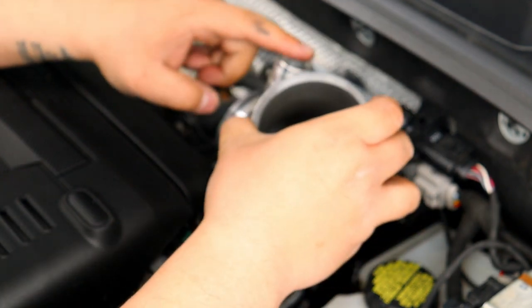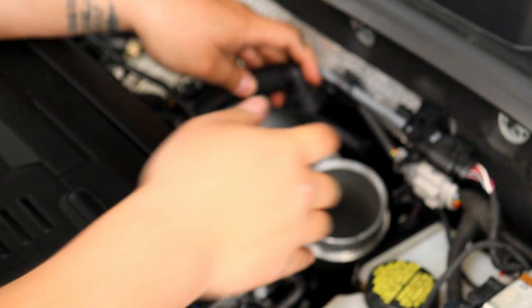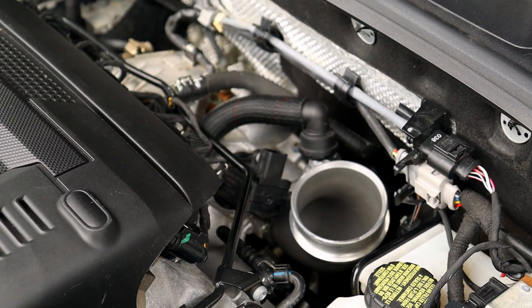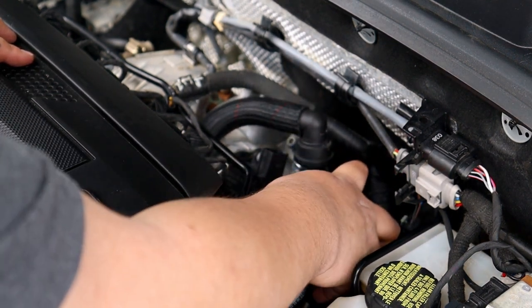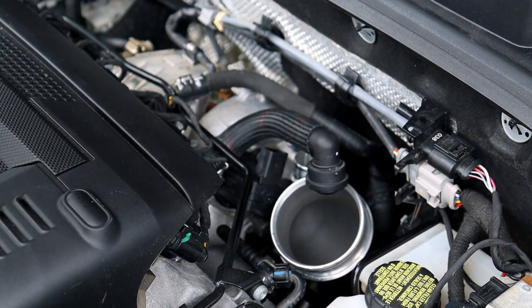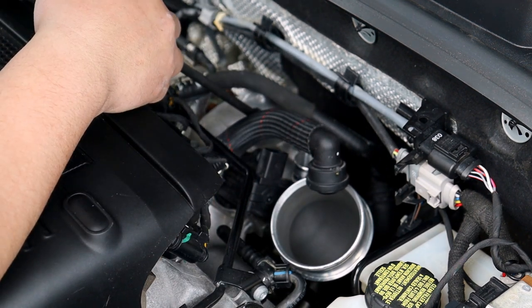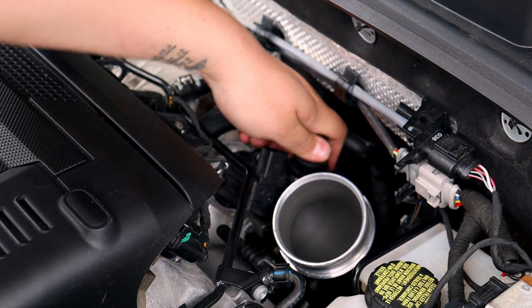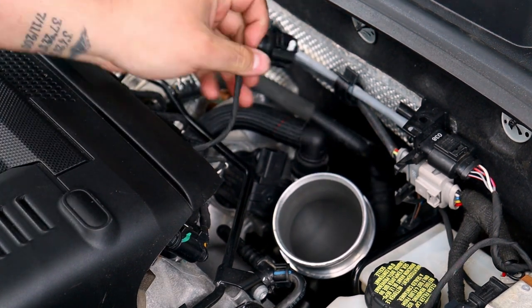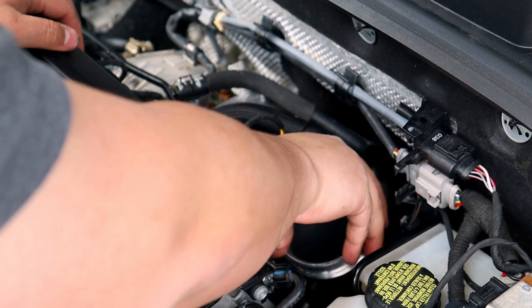Put the turbo inlet so the circle part is facing up toward the sky, then get the bottom end in first and then the top — it should kind of slide in pretty easily and you have quite a bit of room. Once that is in, make sure you rotate the turbo inlet towards yourself, then put the T30 bolt back in tight. After that, put the PCV hose back onto the turbo inlet. Once you've got the PCV hose on, don't forget that connector I took off — it's going to throw a code if you don't plug it in. So just plug that back in. As you can see, I'm just wiggling the turbo inlet right now to make sure it's seated properly.